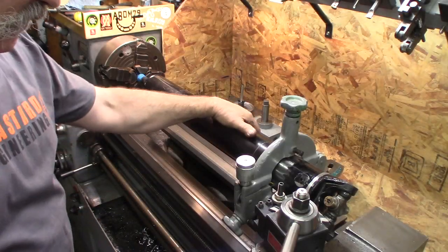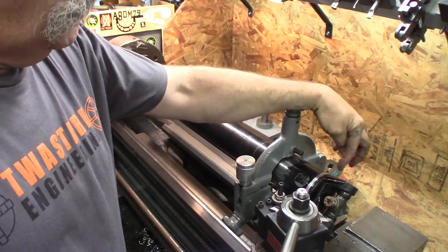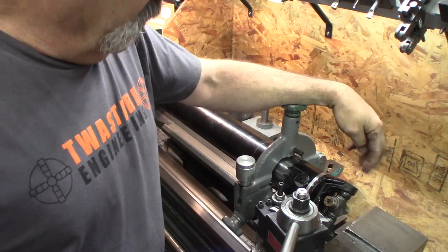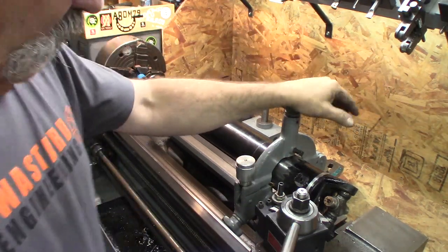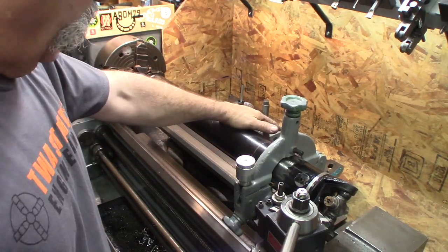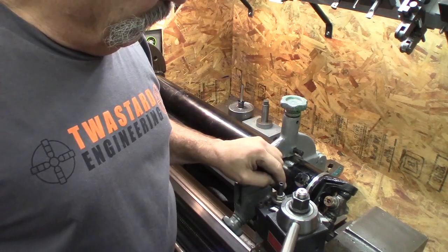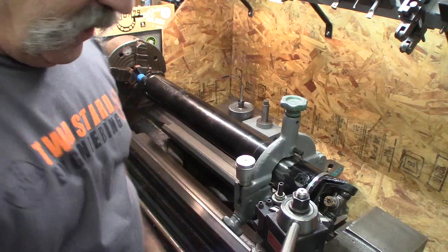Well, we got half of a Toyota driveline in here. And with all the mods my son's doing, he needs a different end on there. So we're going to cut this off. He's ordered a new one. And we'll put it in, and then we'll take it to somebody, probably have them balance it. But we might just balance it on the wheels ourselves, but probably take it to somebody to dynamically balance it. But we can remove it and all that stuff. It's not a big deal. So we got it set up here with steady rest, and we're just slowly cutting this off.